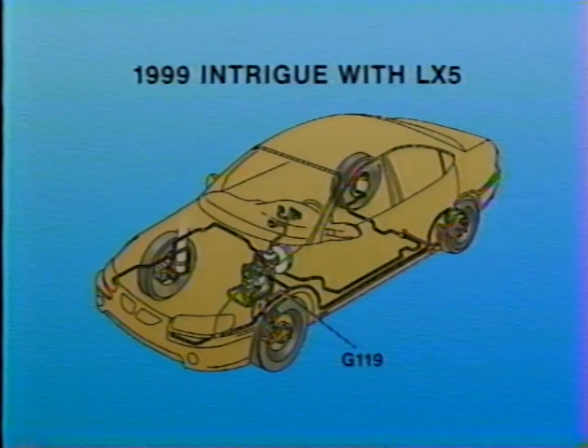Finally, two notes about other ways water can enter other kinds of ABS systems — these occur in systems that have the control module in the engine compartment. Occasionally, leaking windshield washer fluid has dripped down onto an ABS connector, causing that indicator-on condition, so keep that possibility in mind. The second case concerns the Bosch ABS 5.3 system used with the new LX5 V6 engine in the 1999 Intrigue. In other vehicles using this system, water intrusion at an ABS ground in the engine compartment has wicked up to a connector between the module and the engine harness. On the Intrigue, the corresponding ground, G-119, is less likely to be exposed to water, but for an ABS indicator-on complaint in an Intrigue with the LX5, you should remember this possibility. G-119 is at the base of the left-hand strut tower, just below the cruise control module.